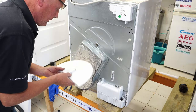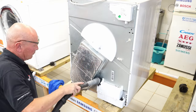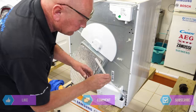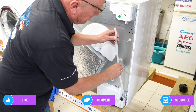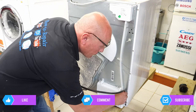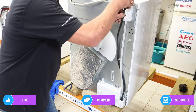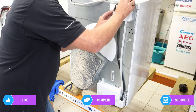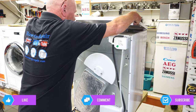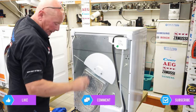We can now put the back cover on — I'll give it a hoover first. Then put the two pipes on: the white one goes into the hole, comes up and clips into place, and the black one comes from the pump and clips into place. Thread them over and put them both on the clips. Now put the lid on: rest it over, drop it down, hold it down on the front, give it a tap forward, then replace the two screws.